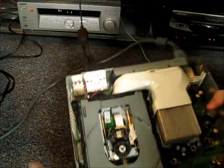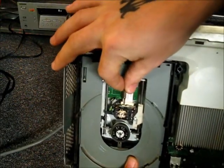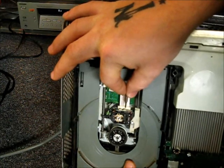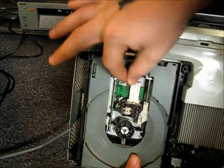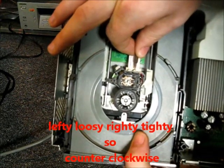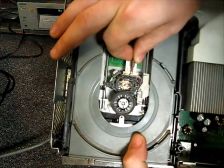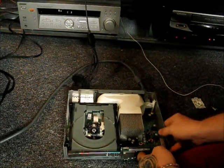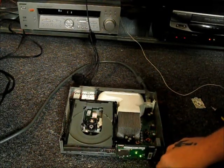What you want to do is — right here on the back of your laser eye — you're going to see two screw-looking dials: one and two. The one on the right, you want to stick a small flat head or Phillips screwdriver in there, and you want to turn that as if you were loosening it — turn it about a quarter of a turn. A quarter of a turn will do you just fine, I promise you.